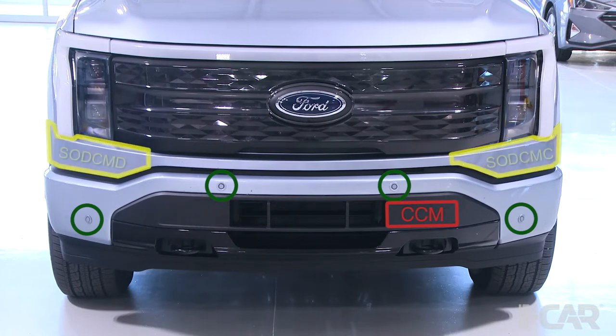And then what we're seeing on the Mach-E's and the other sibling F-150s is where there's the potential of the front corner radar modules that start to play into the Blue Cruise features and things like that. So just be aware of those items if you've got a vehicle hit in the front, damage, where potentially those sensors are located, and where there might have to be additional operations considered as you're repairing the vehicle.